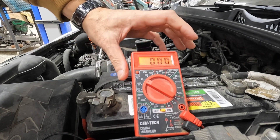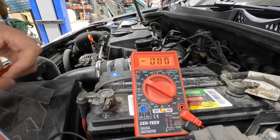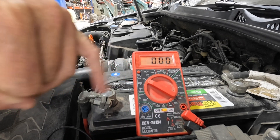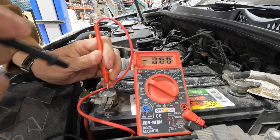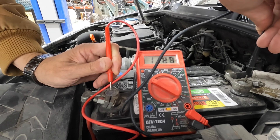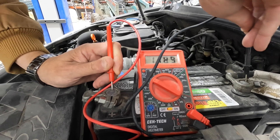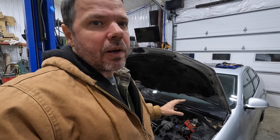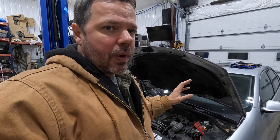We've got this set up in 20 DC. It should have about 12 plus — we're going to be short. Yep, 11.86. Now, is 11.8 or whatever that said — not going to start this car... well, the car will start with that, not much lower. I know the battery is good because it's newer and I've tested it before. The car got rain in it.